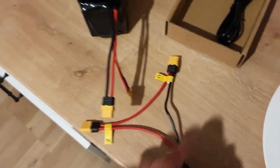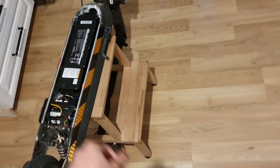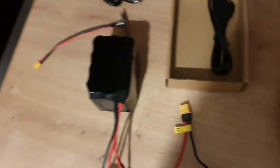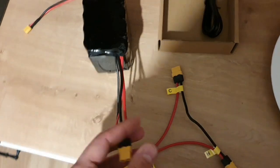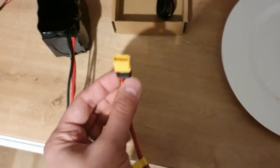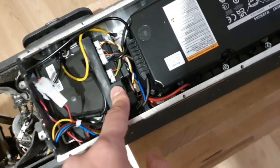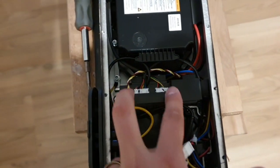And it goes to the controller, and this is maybe charged to, I don't know, 11 volt or something like that. And this one has about 70%, so it's better, I think, to not have them fully charged before connecting them, because of the higher voltage and higher current spikes when you connect it. You will see it or hear it when I connect them to the controller. You can hear it like a discharge, because the capacitors of the controller reside here. When I disconnect the battery, they're going to discharge, and then when we connect it back, they're going to pull a lot of current.